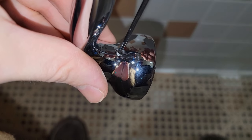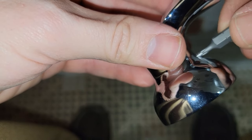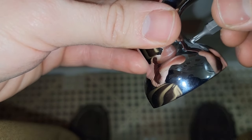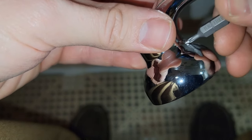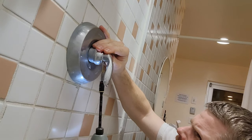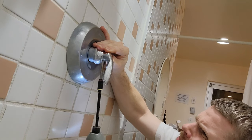Here I have a new handle so I can demonstrate what happens. Basically none of these allen keys fit very well inside of them. Torx heads actually fit a little bit better, so before you go through this next process try a Torx bit — this is like a T10, just get yourself a set of them. Try to jam it in there, hammer it in there. Chances are if you're watching this video you're going to need to drill it out because you've already stripped it.